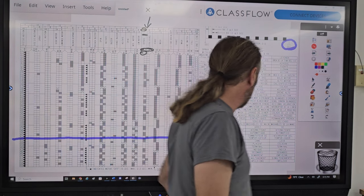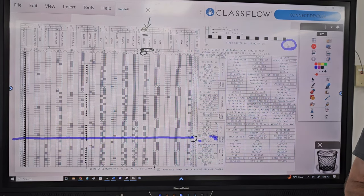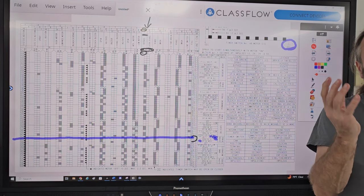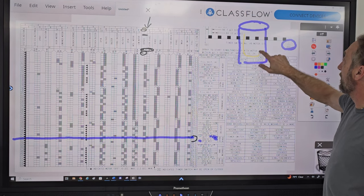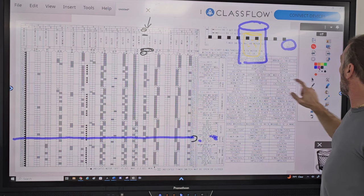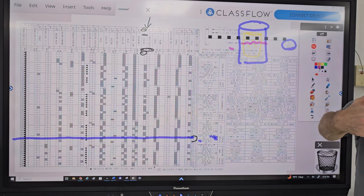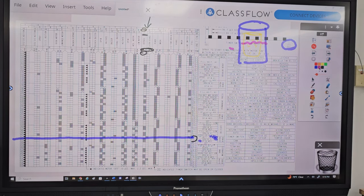And then spin on medium is that if we spin on high, some delicate clothing, a couple things could happen to it. One, we could have excess wrinkles in the clothes. Two, some of these machines spin at such high RPMs that, you know, the washing machine has an outer tub like this, and then inside the outer tub we have the spinning basket with all the holes. So when we fill up with water, the water fills up this high, but it's the outer tub that holds all the water. Whether it's front load or top load, the outer tank is what holds the water. And all these holes in the spin basket...